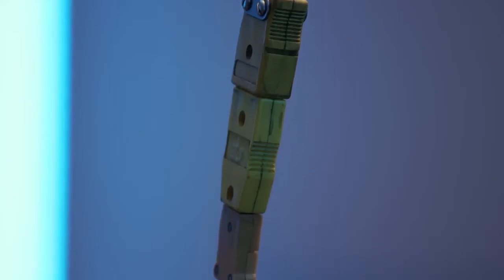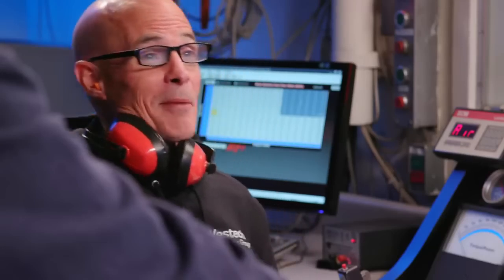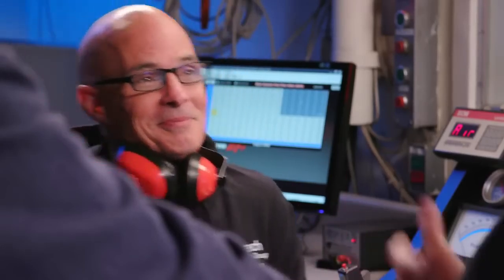I mean, it's all conjecture right now, right? Okay, well, we don't have a definitive answer. We need some means of measuring the air temperature, maybe in a different location of the manifold. Yeah, what if we got it closer to the port? I think what we've come up with is we want to move the sensor someplace else to see if we can read an individual cylinder and gather a little bit more information. That'll give us more information. Is that fair? Yeah. Okay, so we're going to go confuse ourselves even further by putting the sensor in a different hole. All I know is that we get to drill and tap a hole and put something somewhere else, so that's all good. Yes, let's run some stuff through my engine. All right, we're down for that.